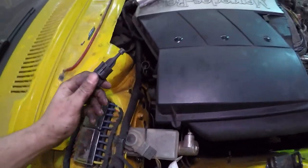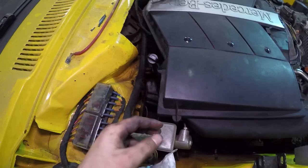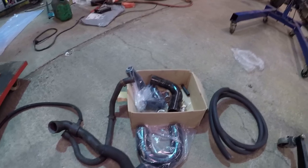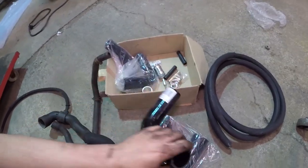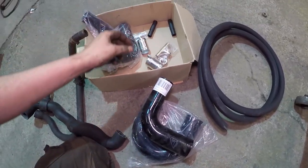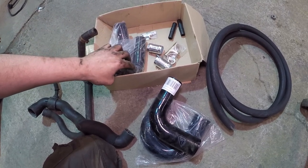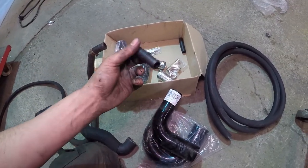It's actually a suck-out pot at the moment rather than a proper dipstick — they don't come with a dipstick. I've tried three times to order a dipstick and everyone keeps cancelling the order because they're not available. We need to move this tube out of the way to get to the heater matrix pipes. I've got here some of the factory hoses which are going to be really useful. I've got a 45mm U-bend, a 45-to-35 adapter, some 35mm couplers I'm hoping, and some 16mm couplers. I should have a 16mm T as well.